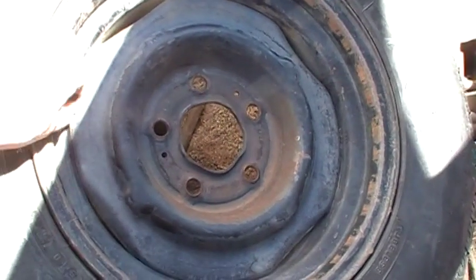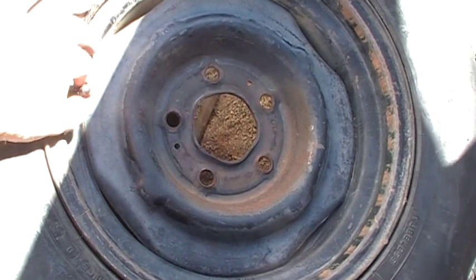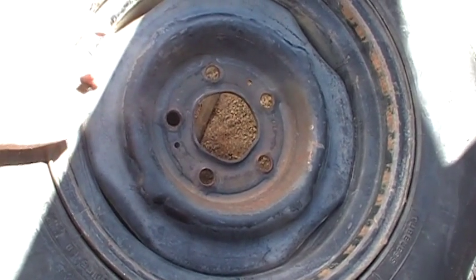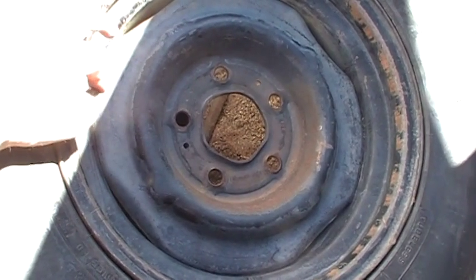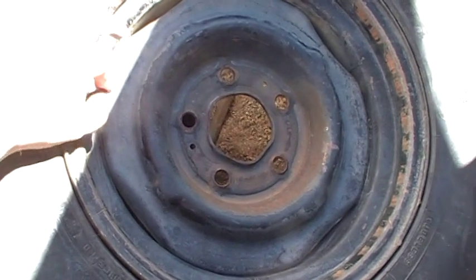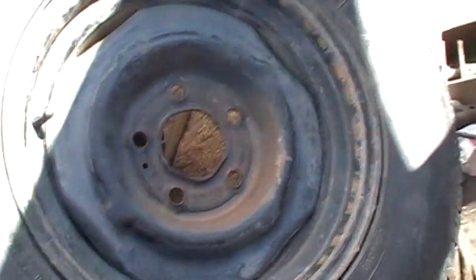Now, the tube. Go over that too. The tube was a brand new tube. Those are completely collapsed. Usually when you get them, they have no air. Do not take the valve core out. I know that's a faster way. Maybe when it took 25 minutes to fill it, that would have been a faster way to air them up. But for this case, leave the valve core in it. That way you don't have to worry about air sucking into it.